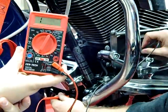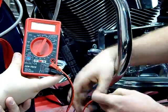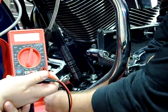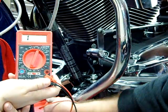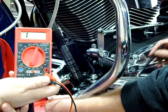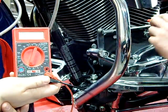Now all of these places will go back — I'll grab one coil from the stator and go to the primary here. No continuity. Obviously I can go to the spark plug. If you don't verify that you actually know you're testing from a good ground, you're falsifying your test and it's not going to do you any good. Watch this — if I go from the stator and look at my reading, now I'm going to go to where we know it's a good ground. My meter shows just the one, or yours would say OL. Now watch this — if I go to this rubber pad, what's the meter say? It's making it look like it's good. You have to know you're testing from a good source.